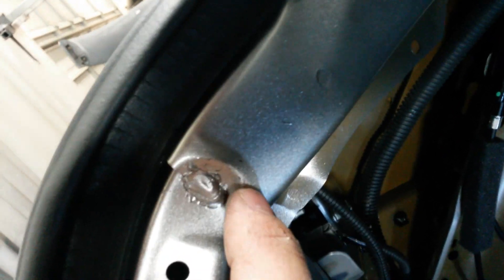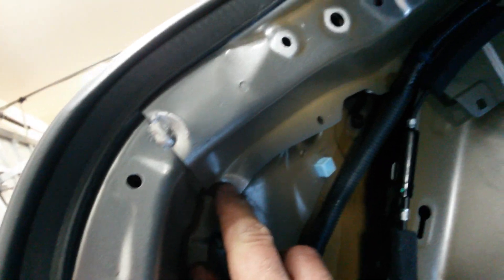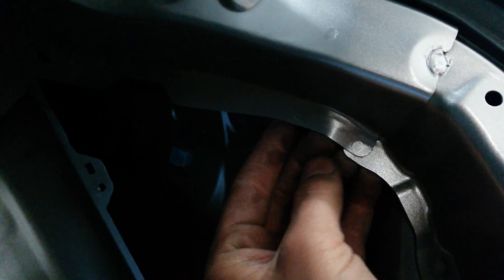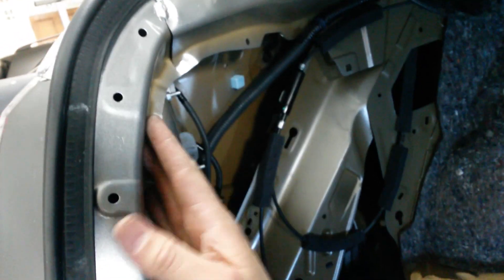I did find up here that this has got a little bit of a buckle in it right there around that weld, and over here also — a little worse on this side. The paint's flaking off right there on that ridge, so I know that's something that happened in the accident, it's not just made that way. I think I'm going to run a port-a-power from right here, probably over to the back brace back there, or maybe somewhere down in the floor in that pocket, and run it up this way to push this out and get some pressure on this so I can tap that back down.